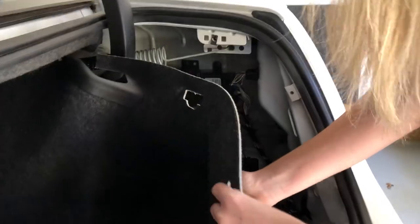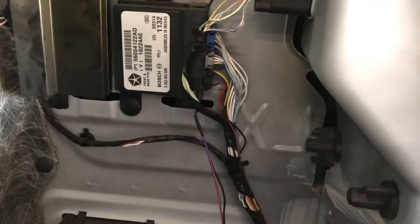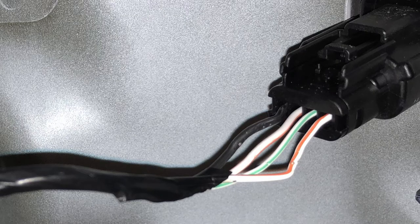We're going to be looking for the plug that's going into the tail light — there are some wires coming off of this plug going into the tail light. Once you have the panel removed, look for this plug here going into the tail light. On the newer models there should be four wires. We're looking for the ground, which is the far left black wire, and then we're looking for the white with orange tracer — particularly the one next to the black wire shown here. That is going to be our power wire: white with the orange tracer. We're going to hook up to that so that we can get power any time the car comes on at night and your running lights are on. It will turn off automatically when your car goes off, and it'll also come on when you unlock your doors at night in the parking lot along with your running lights.